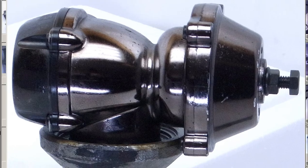The SQV blow-off valve, now the SQV is the little brother to the Super SQV blow-off valve, a sequential blow-off valve. It has a diaphragm in this area here. Boost pressure pushes on the diaphragm, and inner manifold vacuum, which connects to a nipple on the reverse side, pulls on the diaphragm, and the combination of the two, when they're able to make the diaphragm move in resistance against the spring, the flutter in the diaphragm pulls a piston, which runs through this area here. The piston releases boost through the trumpet here, giving that distinctive blow-off valve sound. The flutter, of course, from the diaphragm type blow-off valve.